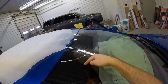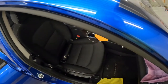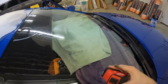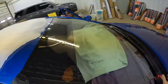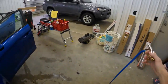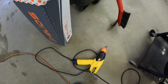Push that wrinkle out — that little guy there, we'll shrink that out no problem. I want to anchor down my edge. That's a carbon blade — we don't want to cut on glass with that. Now some windows you're not going to have this luxury, but we have from the paint to the dot matrix an inch and three eighths, so we have plenty of room. Now I'm wet-shrinking it — if you're new you probably don't want to try this, it can be tricky. I don't like wet-shrinking back windows, but I don't mind wet-shrinking strips.